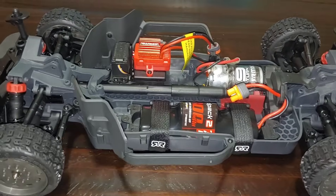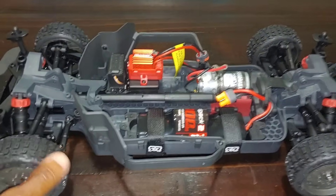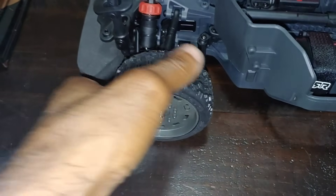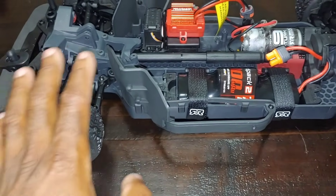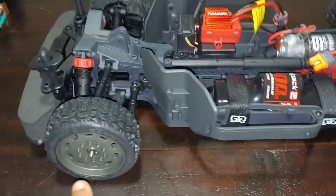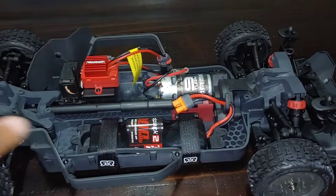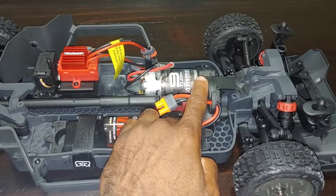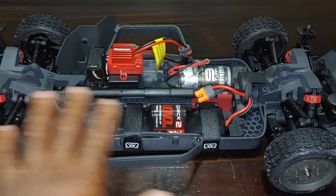Looking at the shocks, they did improve them and these look like threaded body shocks — actually no, they're not. Overall I'm not going too in-depth here. This is brushless-ready, which I'll put to the test. One of the biggest differences between this and the Vendetta — beyond one being brushless and one brushed — are the tires and wheels. These tires feel pretty good, a little harder than expected but they'll last a lot longer. They're 14mm hex. The gearing is different too: this has a 55-tooth spur gear and a 15-tooth pinion, whereas the Vendetta has a 55-tooth spur and an 18-tooth pinion.